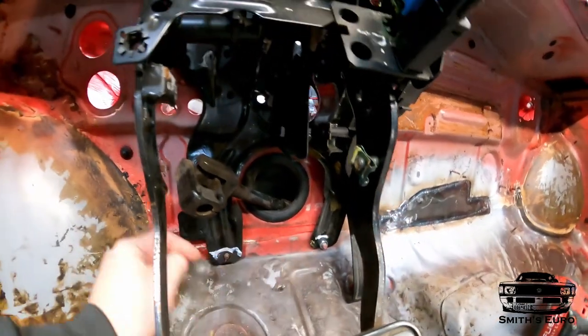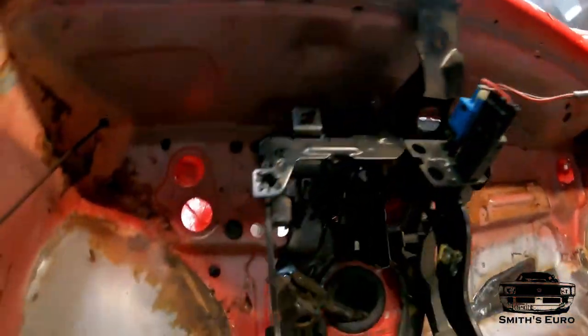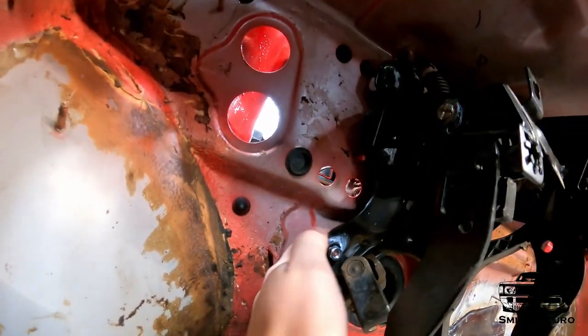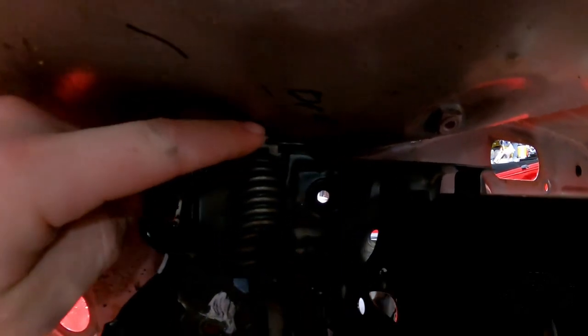The easiest thing is to make sure you have it into every OEM mounting point. There's a stud down here, a stud down here, a stud over here, and the more important one is this stud up here. I have them all loosely tight for now. What I'm doing is taking my sharpie and finding things that need to be cut or dented. Right back here there's a little clip — if you had firewall insulation it would be a plastic or metal clip that holds it in place, so I'm just going to lop that off. I put an X on it. Also your clutch cable spring attachment point at the top — I just outlined it and wrote 'dent,' so I'm going to whack that with a hammer and that'll solve it.